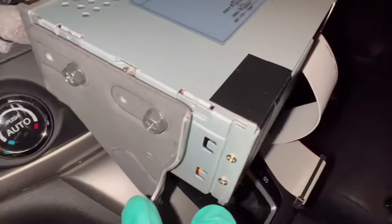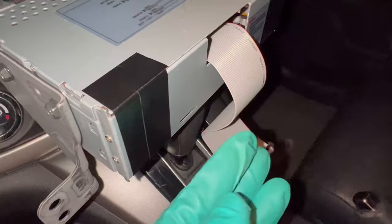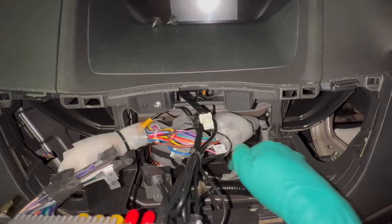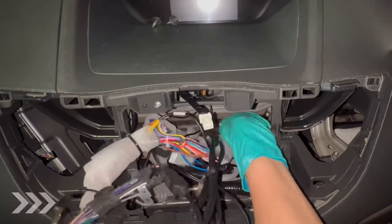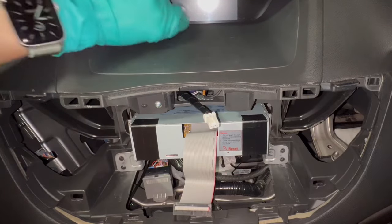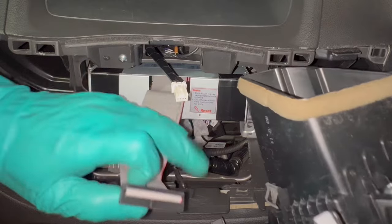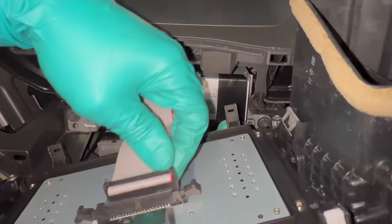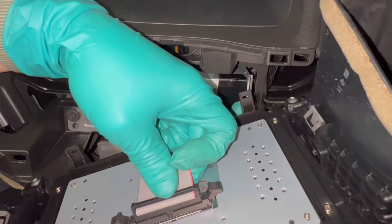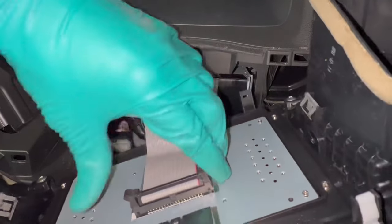I had the angled side of the brace closer to the front so the metal enclosure is as far back from the LCD as possible so they don't touch each other. I'm pushing down all the wires towards the back where there's more space, then screwing the bracket on. For the screen, bring it close to line up the ribbon cable with the clamp on the LCD — make sure both clamps on each side are in the open position, then once both sides are aligned, close the clamp one side at a time.